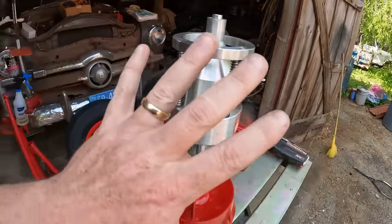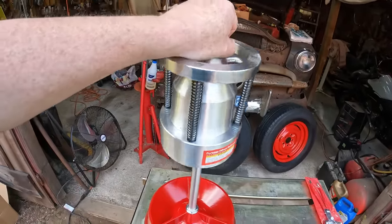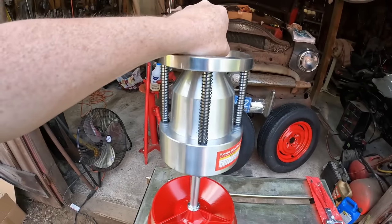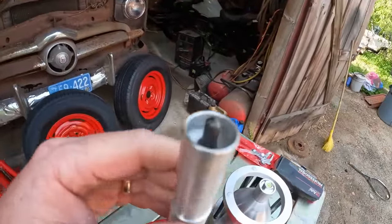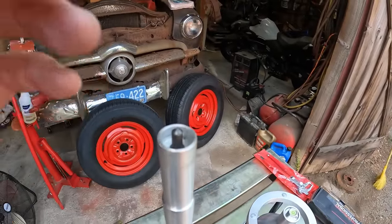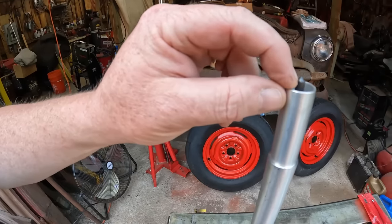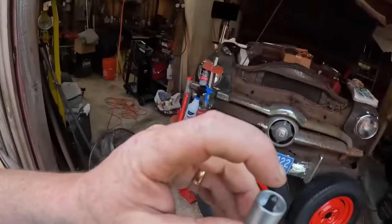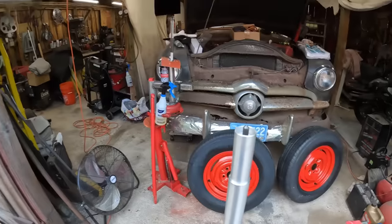The cheapest thing you can do is work with what you have. Watch — I'm going to push down on this and wiggle it around. I can feel resistance, and I'll show you why. This has aluminum all the way around not at the point, but at the base of the taper. That's telling you that instead of resting on the tip of this pin, it's actually resting on the internal cylindrical part of the hole. That causes resistance, and if this unit has resistance you're never going to be able to balance a tire well with it.